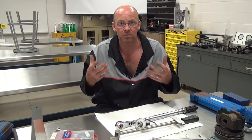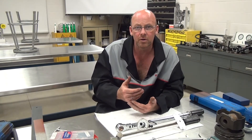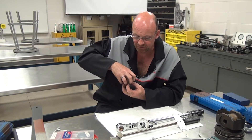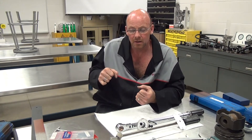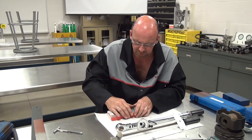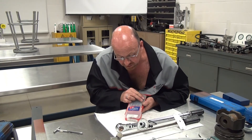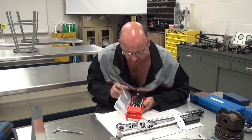We don't want to run that risk, especially if it's something holding together a rotating assembly like the bottom end of an engine. In the case of over-torquing, sometimes what happens is we get thread pulls or stripping. The pull is where we're actually starting to pull the thread — it hasn't quite stripped yet, but it will strip if we keep turning. If we do strip a fastener, we can do a repair with a helicoil kit. This happens to be a helicoil kit for a 3/8 National Coarse 16-threads-per-inch fastener.